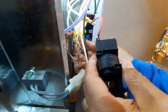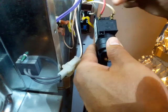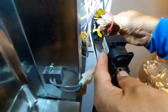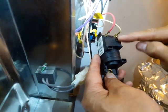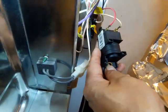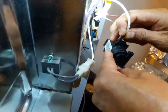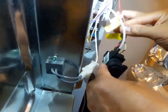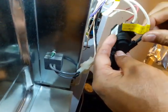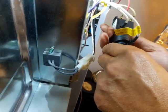The neutral wire goes right there — you can't interchange these two. The other two wires go to the igniters: one up on the stovetop and one down here. You can interchange those two, because when you turn the knob both igniters get power simultaneously. So it doesn't matter if one goes to the left side or the right side. Just plug it in — luckily this replacement part uses different-sized connectors so you can't mix them up.